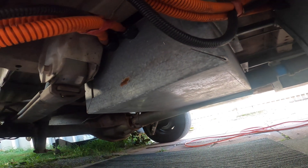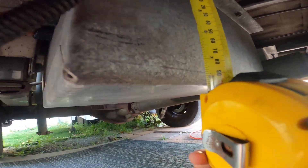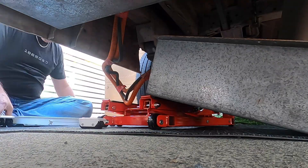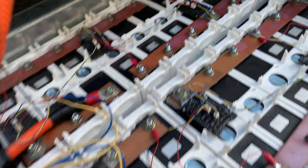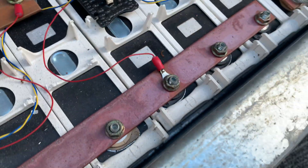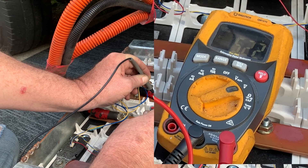After finding just 16 volts on the traction battery, I'm pulling one of the battery boxes out. It's about 200 millimeters deep — more than enough space to get it out from underneath the car using a motorbike or ATV lift. There are about 18 cells in this box, and they are floating around — not secured in any way. There's no mechanical means to stop them bashing against the walls. There is a bus bar that goes all the way across the back.